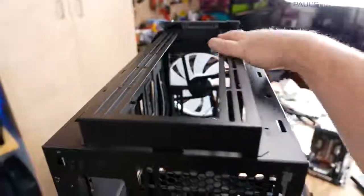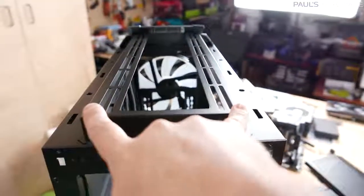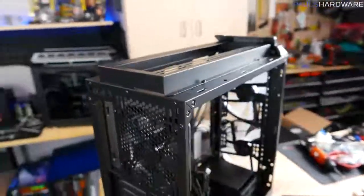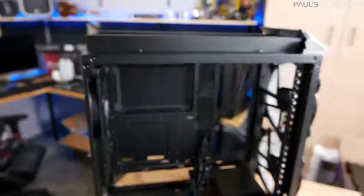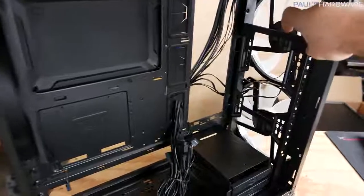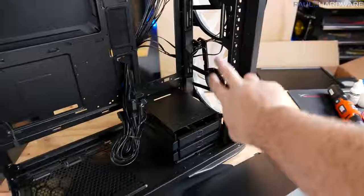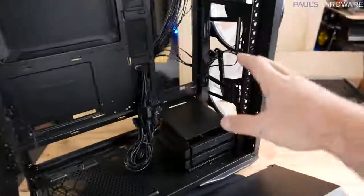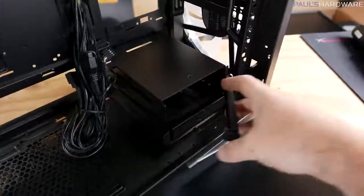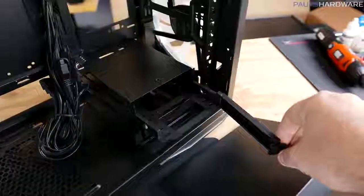And also, as you can probably see, a crazy amount of support for 120 millimeter or 140 millimeter based fans, in I believe three or four fan configurations, depending on which size fan you are using. So that's pretty cool. There is a similar configuration, although you can't remove the piece, at the front for the radiator, but tons of support up here for radiators as well in 2-fan configurations. You might notice a drive cage down at the bottom, so if you do have 3.5-inch drives, you can pop them in there. It is on this rail system that allows you to slide the drives out. However, do note that the drives are sliding out forward here.